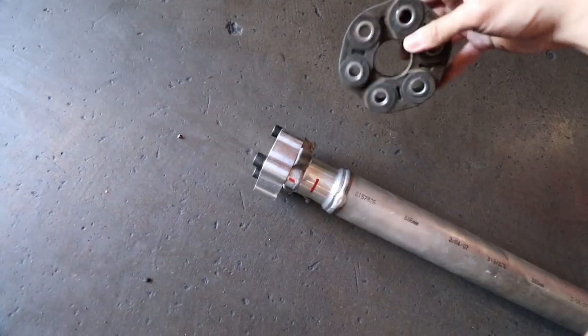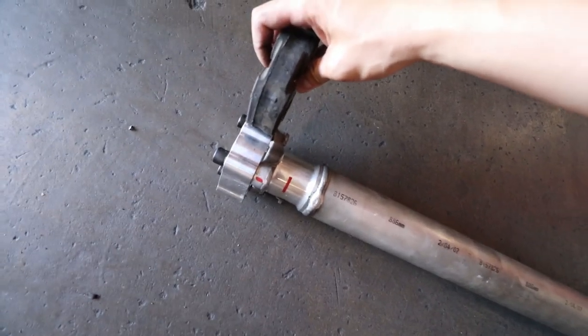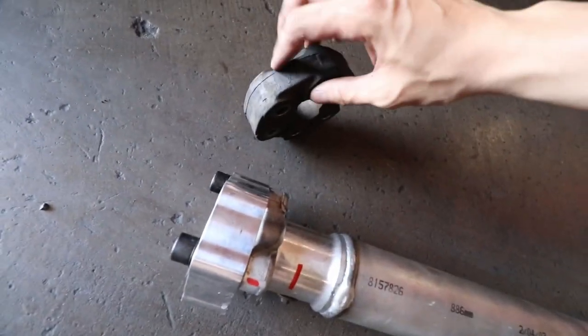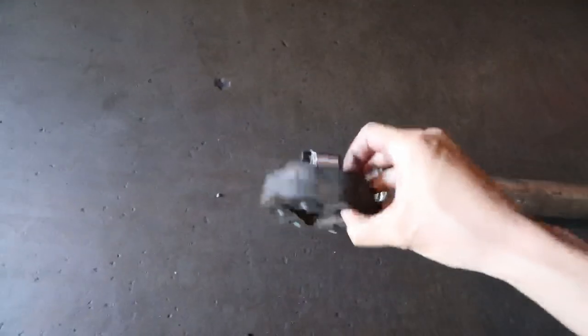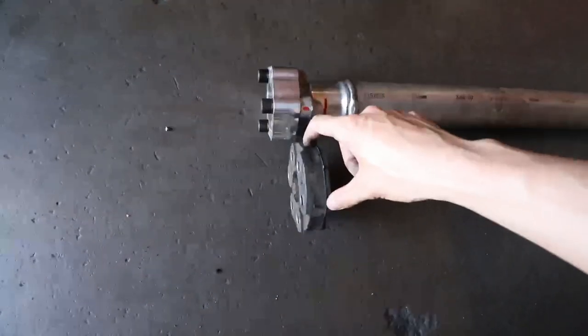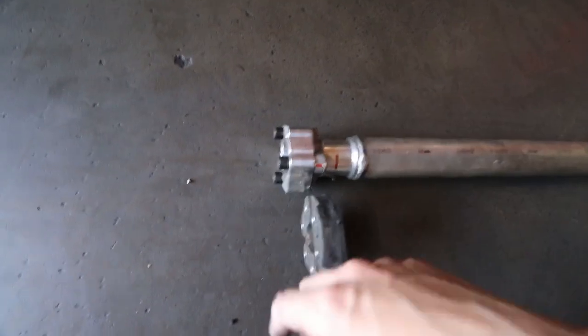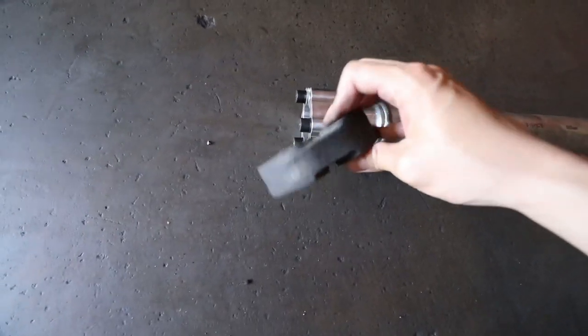So my car was at the shop and I thought everything was fine until they told me to order OEM ones, and I'll tell you guys why right now. First reason being is this is just a little bit bigger than the OEM piece, and they're worried that if we put this back in here, this and everything else won't fit. And then another issue is this absorbs some of the shock, right? So instead of the shock being absorbed through here, it's going to be absorbed in the bearing, which means I'm going to have to do this job again. And honestly, this is kind of a little bit overkill. So I think I'm just going to order OEM pieces, and I don't really need this.